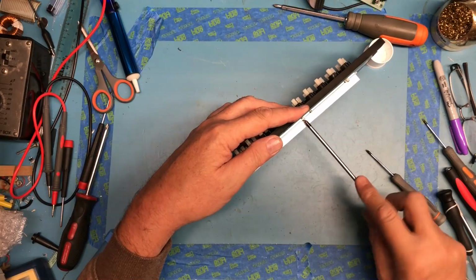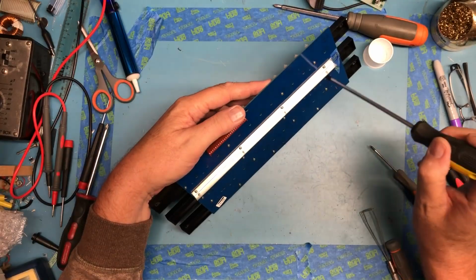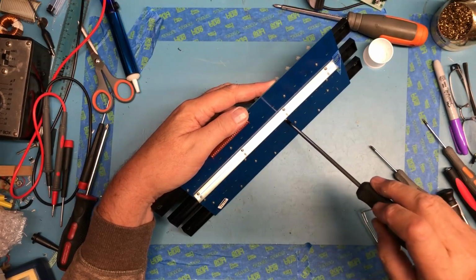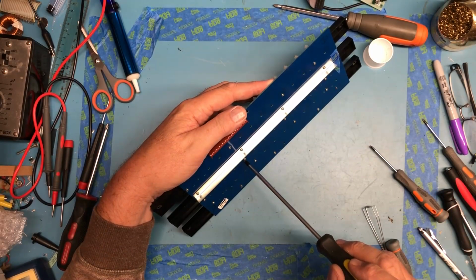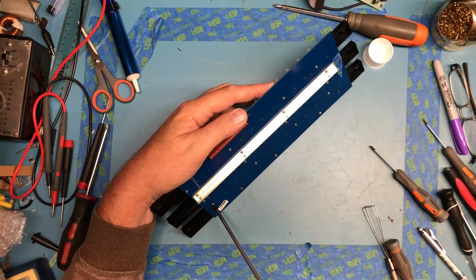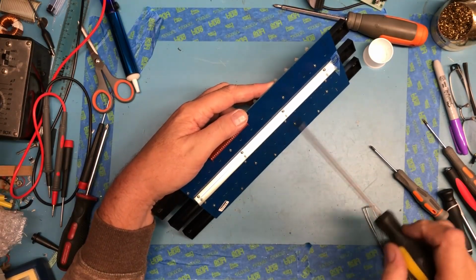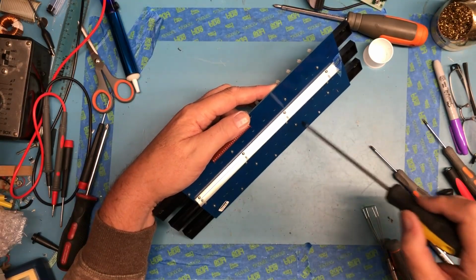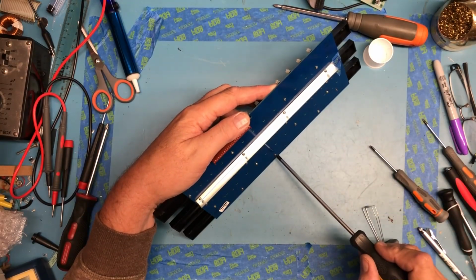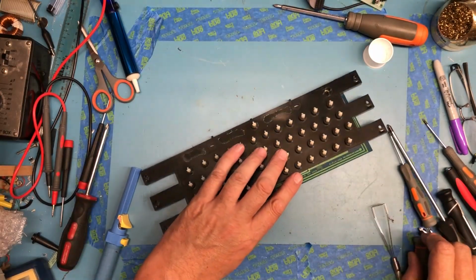Yeah, my Apple I that I built, the clone that I built, the keyboard on it seems to have come out of a Franklin Ace Apple II clone, of all things, and I of course had to build an adapter for the connector for it because the pinout wasn't compatible. And of course, in exploring the Apple II here, I see that people make adapters just as I did to adapt an Apple II keyboard to the Apple I for people who are, what's a good word to use here, curious enough to try to put together an Apple I.